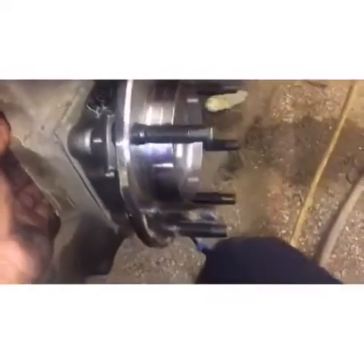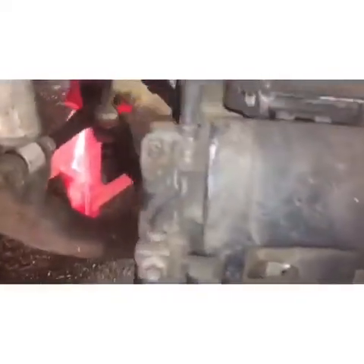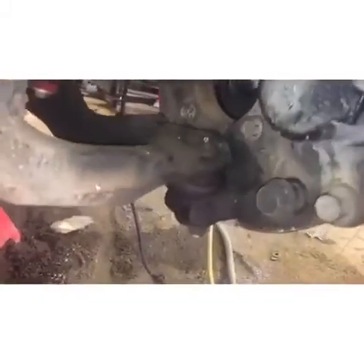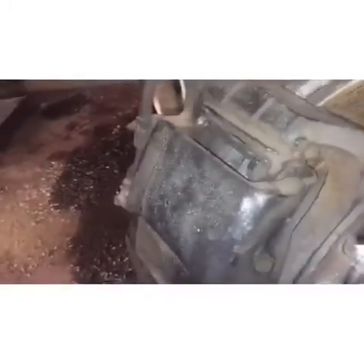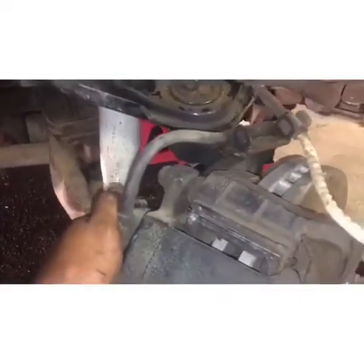All right guys and girls out there, I got it back together. I haven't tightened it down yet, but I just wanted to show how it looks. You can tell I got the 21 millimeter bolts ready to be tightened down. We just got to reconnect the ABS sensor from over there — it's an easy one. We still got to do the other side, but it will be the same process. Please leave a comment if you like the video, and until the next video, bye!